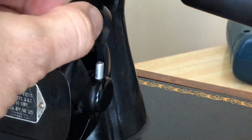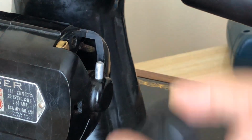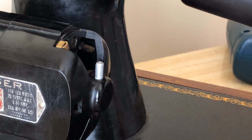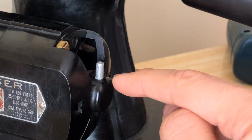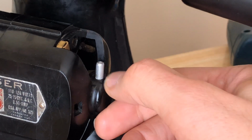And anyway, all that's left now, and you'll see this little cutout here, is designed to make room for the grease port. By the way, before I put this back in, let's make sure this has cooled, because things get warmed really quickly with a heat gun or even a hair dryer. So anyway, you can also use this technique on Singer Featherweight motors or any other sewing motor that has a grease port and a wick.